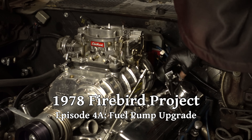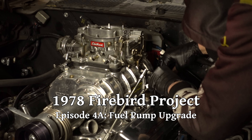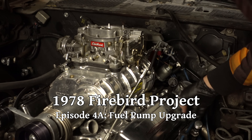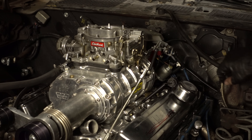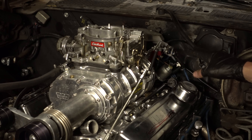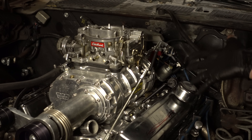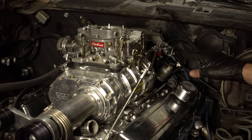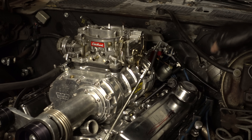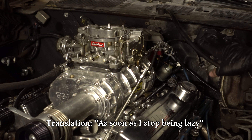I'm going to push the transmission cable out of this bracket because it's going to be too short. The throttle cable is fine, but the transmission cable is definitely too short. So for right now at least, we just won't use the kickdown. All that means is it won't downshift at high throttle, which is really not a big deal. That only matters for performance, and I really just need to see if this engine is going to blow up or not. I already have the longer kickdown cable, so I can hook it up as soon as I want to.